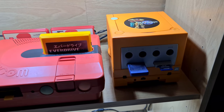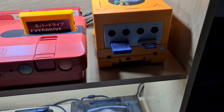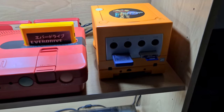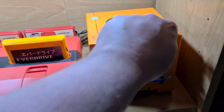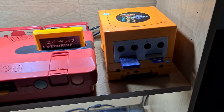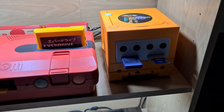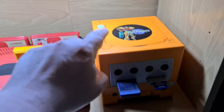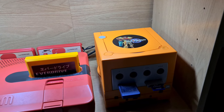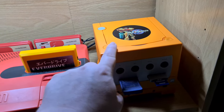This is a spice orange GameCube. As you can see, I've got a memory card in the front. You've also got an aftermarket adapter which allows you to use an SD card, and I've got the Game Boy Player. I use this mainly for Game Boy Player. With the Action Replay, you boot into a thing called Swiss. Swiss will boot on the memory card. Swiss will allow you to play a thing called Game Boy Interface — instead of the standard Game Boy Player software, it uses Game Boy Interface, which is like a lower latency, higher quality, crystal-clear Game Boy player. That's how I run it through the SCART cable and it's just incredible. I've got the Xeno mod chip, though you don't really need it if you've got the Action Replay — you can just get away with the Action Replay to boot into Swiss. I don't really play GameCube games on this; I play them on the Wii, because of component — and the component cables for this are very expensive, like a couple of hundred pounds or more.